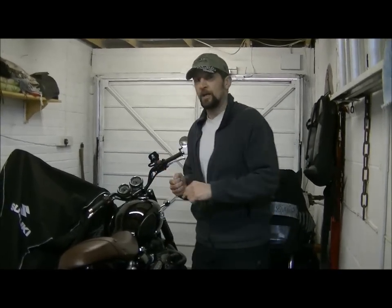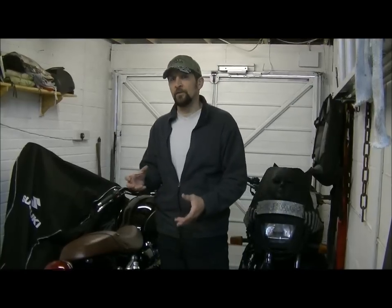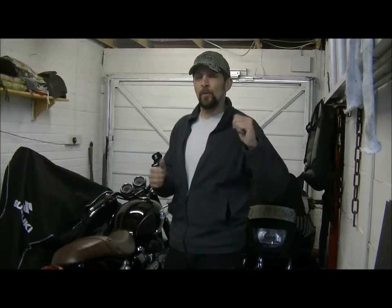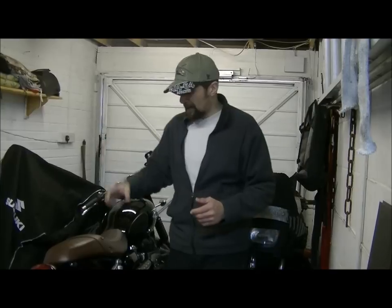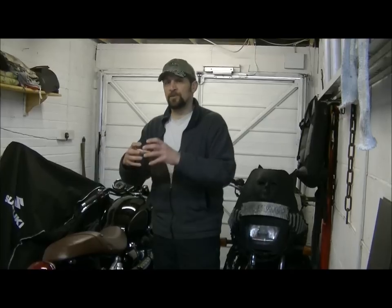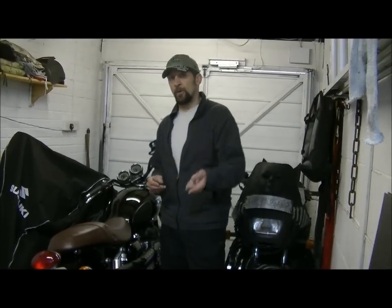I'm going to show you how to rip it out and repack it, put it all back together. But before we do that, I'm going to do a before and after — just run the bike up to give you a sound of what it's like now. The reason I'm doing this today is it's echoey, this thing echoes like hell. It's fantastic for setting car alarms off, but it is a little intrusive. So listen to that empty, hollow sound where the sound waves echo inside that pipe because there's nothing to stop that sound expanding into the outside of the cone.